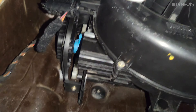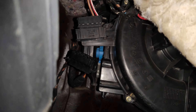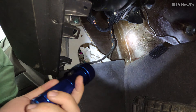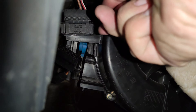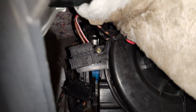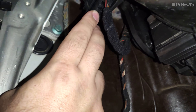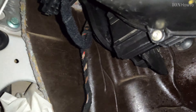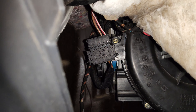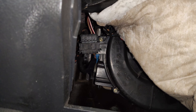The screw is installed T15 — another one on top. Watch how hard it is — they fall all the time. Eventually I had to stop recording so I could get the screw in. That's where the screw is supposed to go in. You tighten it but not super tight — it's plastic, so try not to go too far. Plug in the heater blower fan, the AC fan. These are the screws for the glove box — that's another video, the link is in the description. Before you put the glove box back, test it.